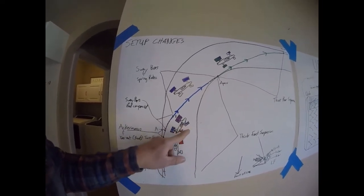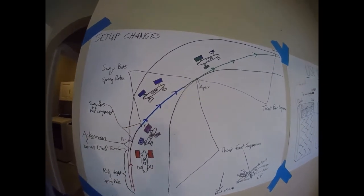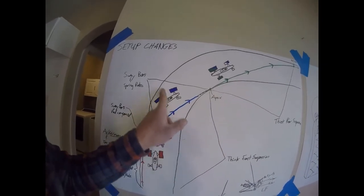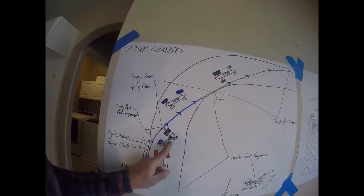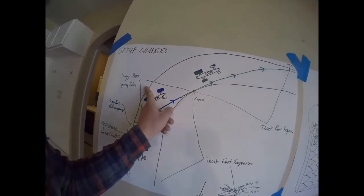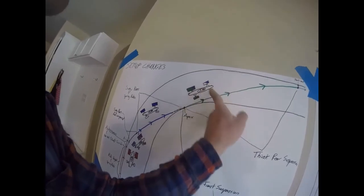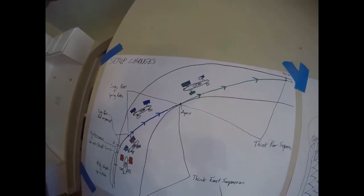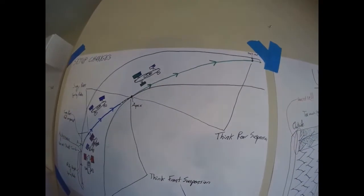Now, from here, you're basically not touching the throttle or the brake, and you really are trying to transition the force to go full lateral. Here you would have the force going in a vector this way, and you would want it to continue to go that way. Back here after the apex, you want the force vector to be changing again about another 45 degrees, but hopefully this is a little clearer on the visual part of it.